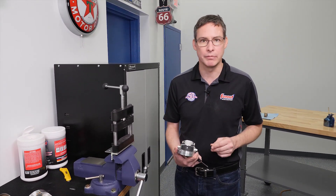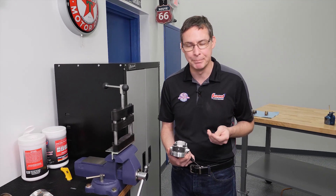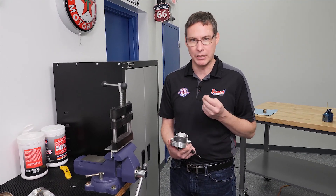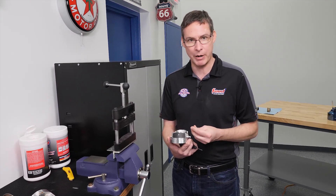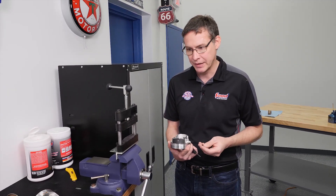When you're installing spiral locks, there are about three critical areas where it gets to be really tough, and that's at the beginning, the middle, and the end. How do we make the job a little easier? Getting the first spiral lock in is going to be the tough one. Once you do that and you have the wrist pin slid through, you'll be able to load the second spiral lock against the pin — it'll keep it aligned and be much easier.